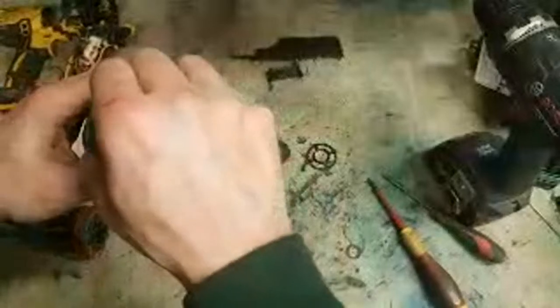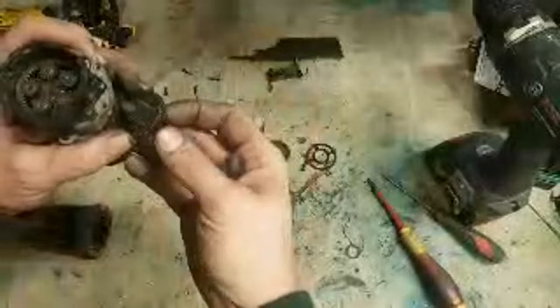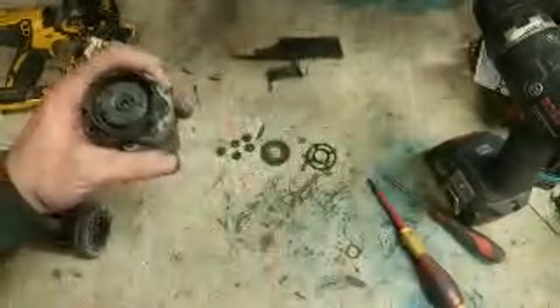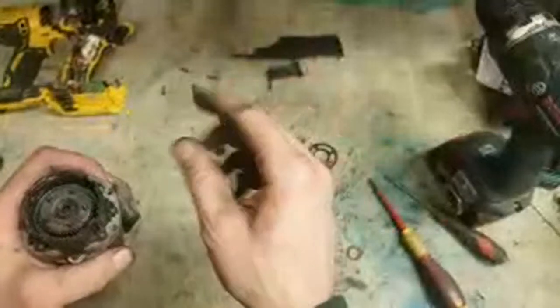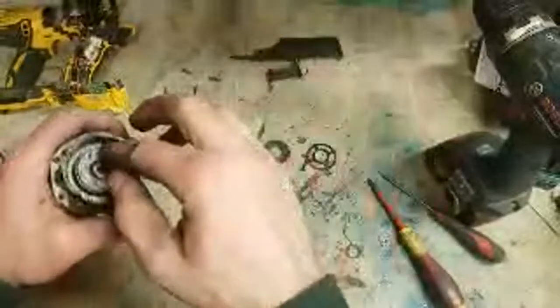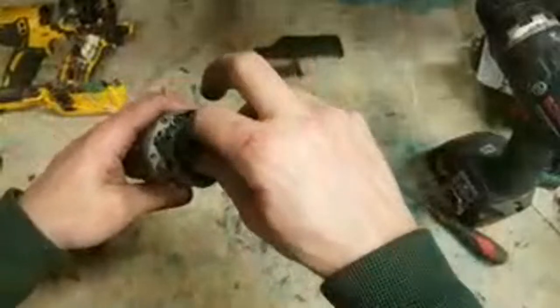Generally, it depends what brand. There's the problem, not on it. Some of them, the actual gear wears out. The bearing that's going in the gearbox causes the wobble. Some of them it's an actual bearing, some of them it's like two cup washers with ball bearings on top. Can re-put them back together again, but it's a wild finicky. And if the chuck's gone as well, generally that's going to be more worthwhile replacing the drill, to be quite honest.